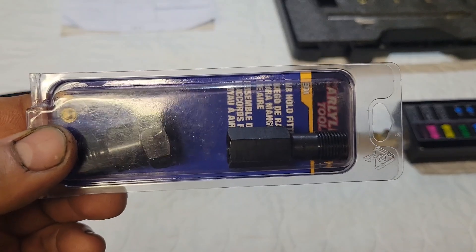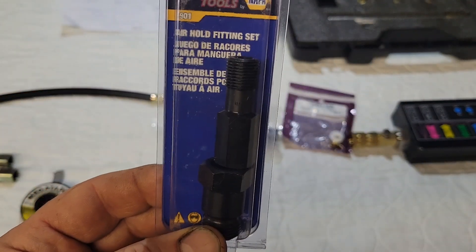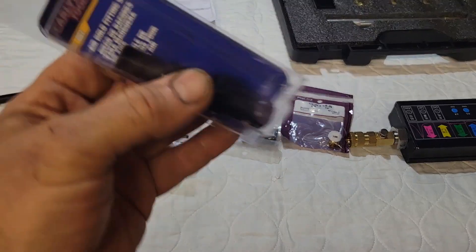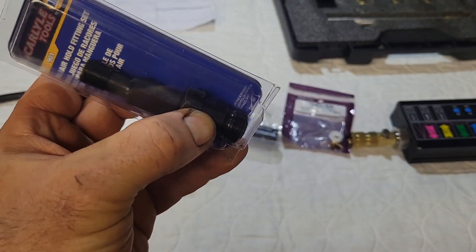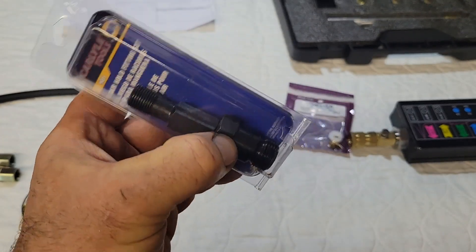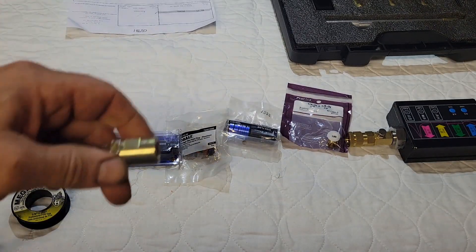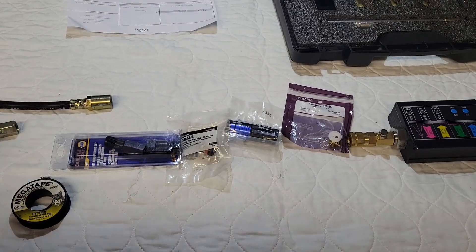This was a find — I got this from Napa. I was going to order from Amazon, but this is for changing valve springs while the engine's still in the car. You put this in the spark plug holes and it goes to an air fitting. So this quarter-inch air fitting will fit into this M12 one, and you also get an M14 one in case you need to blow pressure into the valve. I just didn't have one that went to a quarter-inch airline. That's going to go to M12 thread, which will go to the Rodkey hose or Rodkey extensions.